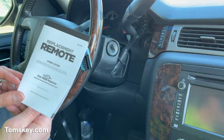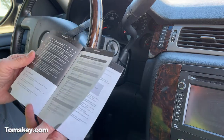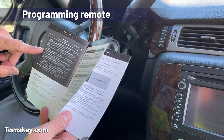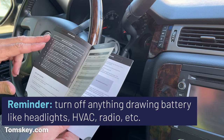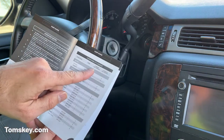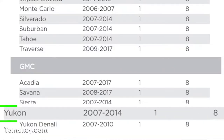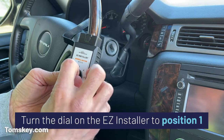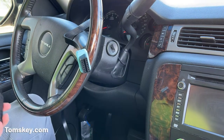I recommend you read through this instruction manual and watch this video a couple of times to get familiar with the process. There are some important notes, like making sure your vehicle battery's in good condition — turn off the headlights, turn off the HVAC. We don't want to drain the battery while we're doing programming. Find your vehicle and figure out what the primary dial position is. In this case, we're working on a Yukon: it's number one, and number eight is the alternate dial position. Turn the dial to number one. Vehicle is turned off, and I'm in the car with all the doors closed.